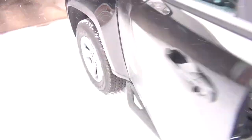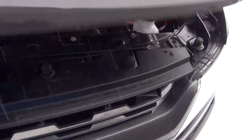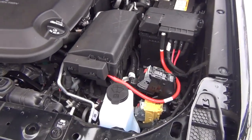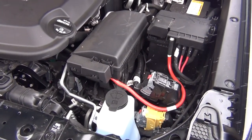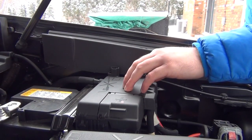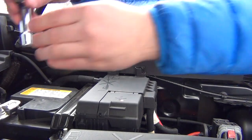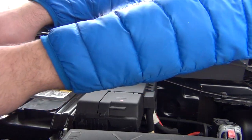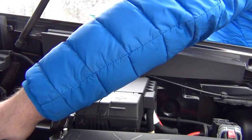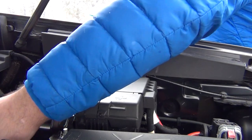We're going to go ahead, unlatch the hood, and set up our electrical boxes. I keep mine in the garage when it's not in use. We'll go ahead and connect these up, then drag our plow out. As always, we'll take off our battery terminals first so we can connect up our control boxes — start with your negative end first always. Just take a 10mm, loosen this guy up.